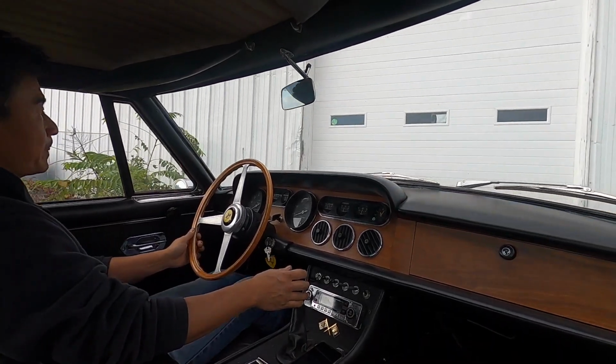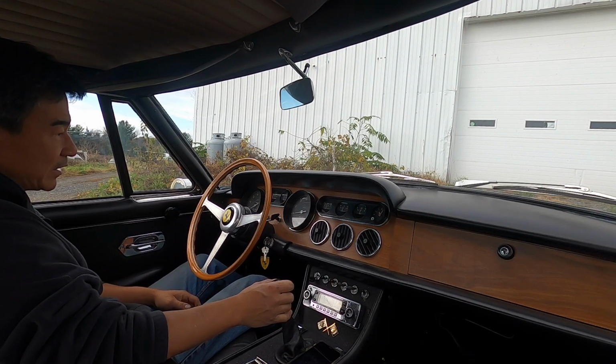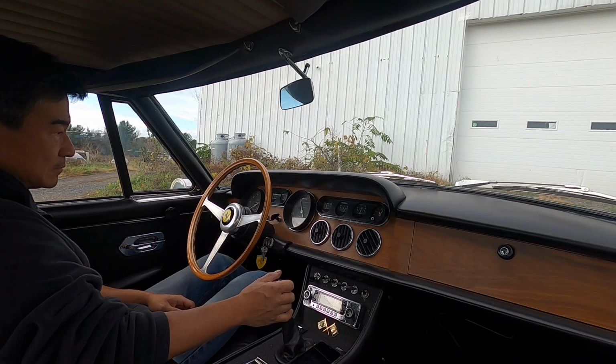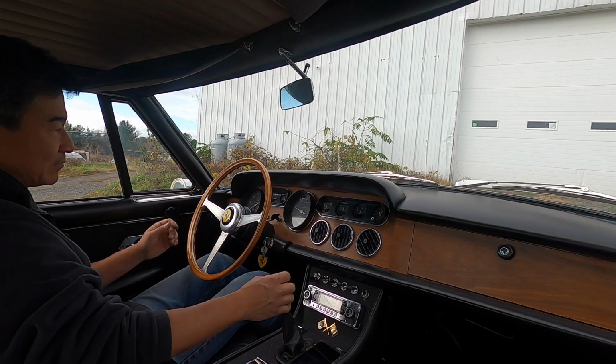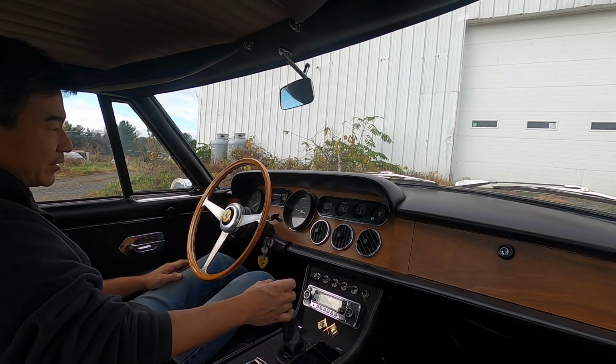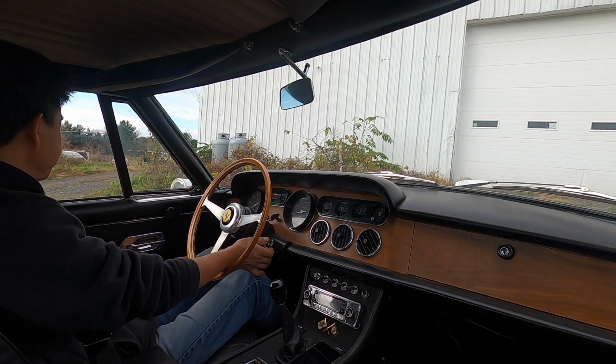Let me see. Boy, this high idle just drives me nuts. It's better now. You can hear it, it's down to about 800. But see that? It's so lazy. It should snap up and down. And as the engine warms up, now I'm seeing oil temp move. That carburetor, or some warped base plate or something, is just sucking in more air, and you can hear it lazily coming down. Now it's at 1,000 and dropping, 950. It's just lazy. There it goes. Now it's at 900. Now it's about 800. Cooling fans just kicked on. All right, well, let's see what we got. Let's take it inside.